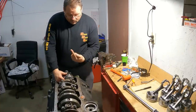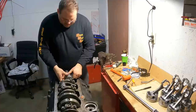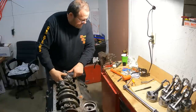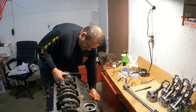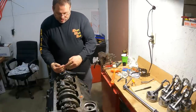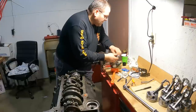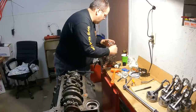Now, remember, if I had rod bolts sticking up here with cap nuts, then I would have boots on those so they didn't scratch anything. And then I'm just going to turn my crankshaft. And I'm down in it. So, yep. All right, so that's in there. I'm going to make sure that's seated. The reason I'm doing that is so that if it's a little bit crooked, that'll square it up. So it's important to get it sitting on the crankshaft and then give it a bump where it'll seat up, okay? Then I'm gonna turn around, put a little bit of moly right there.